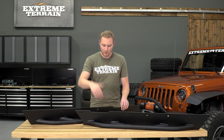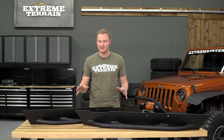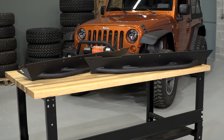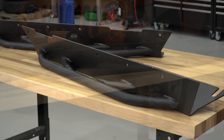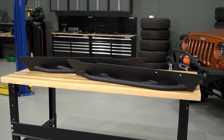If you do keep paint on these, they are going to hold up for a good long time and provide a ton of protection. Speaking of protection, the bars that are welded onto these rock sliders as steps are tilted up a little bit, and that is not by accident. That's to help you slide off of obstacles as you're using these as rock sliders. Sometimes the bars on your rock sliders will be angled down, which can make them a little bit more useful as a step, but can also get you hung up when you're on the trail. All in all, these are built specifically for the trail, offering a ton of protection to make sure that you can slide through obstacles without getting hung up.